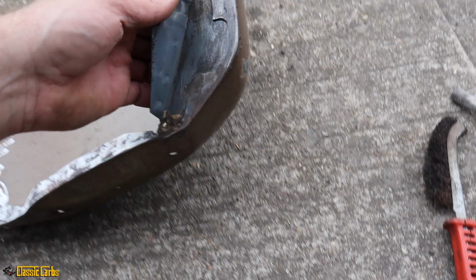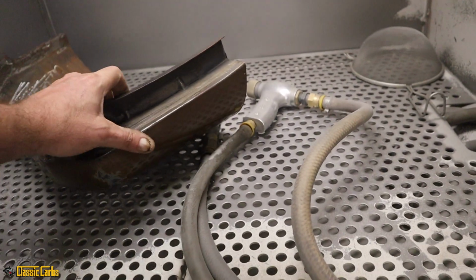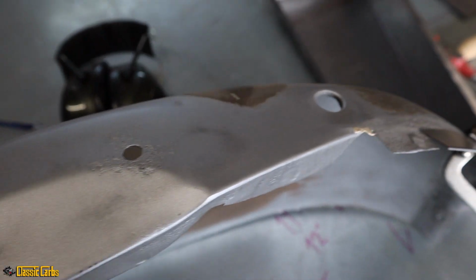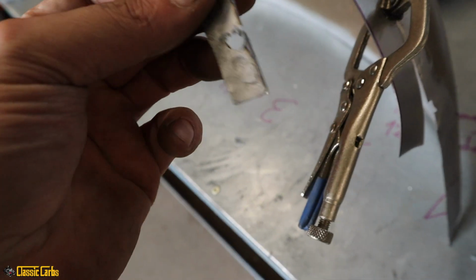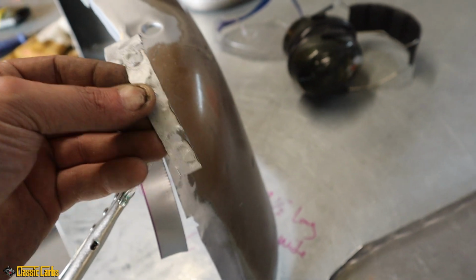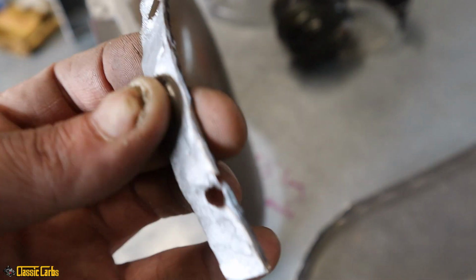That's where the panel is going to go on. So what I'm going to do is bead blast this area here. So I've bead blasted it, and I can just about make one little spot weld there. I've removed the inner excessive layer, and I've bead blasted all the edges to give us a nice clean weld. This is the lip that is part of this panel, and it goes between the other panels and gets welded. But as you can see, it was a bit crispy.